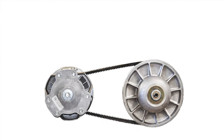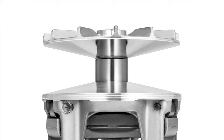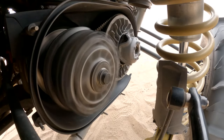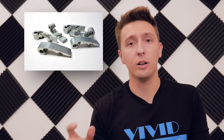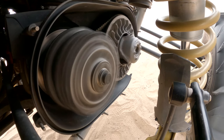The primary clutch is typically attached to the engine crankshaft and it has two sheave faces. One of the faces is fixed to the rotation of the crank and the other sheave can move in and out to engage the belt. In most CVT transmissions, the CVT faces are fully separated at idle and the belt will ride on the post or shaft. Since the belt is not engaged by the sheaves, it allows the engine to idle without sending power to the wheels. The sheave movement on the primary clutch is determined by a set of weights which respond to centrifugal force. As your engine spins up it starts to spin up that primary clutch, spreading those weights and pushing the sheave faces in or out depending on whether you're accelerating or decelerating.